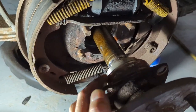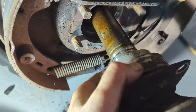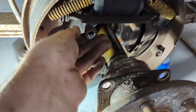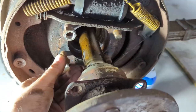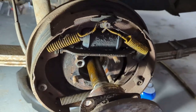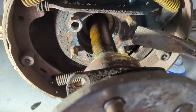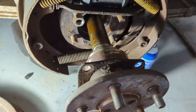Got the second side out - the driver's side. This one was rusted in pretty good. This bearing is loose and groggy. It's probably not as bad as the other side, but it's still pretty bad. I had trouble getting it out and I don't have a slide hammer. What I did was put one of the nuts that came off it onto a couple different spots, then took a crowbar. When it's in place, you can get it in behind and pop it against the wheel flange - don't pry on the brake parts. I got it broke free and popped it right out. If it had been in any harder, I'd have had to get a slide hammer.